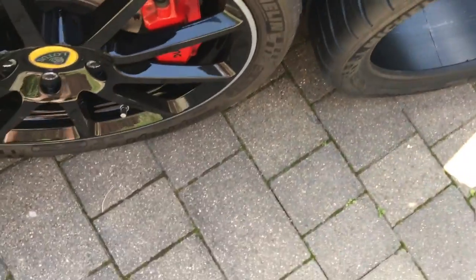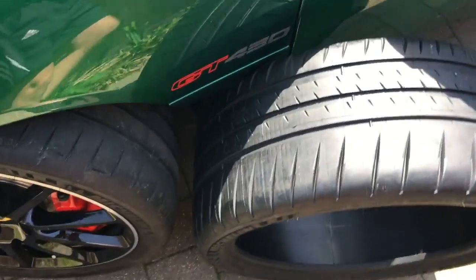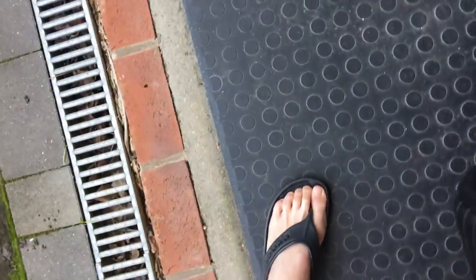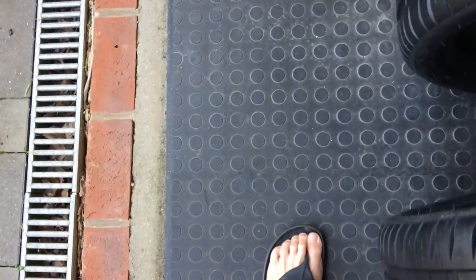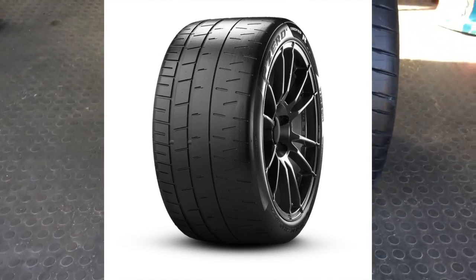Because I am seeing much higher wear on this side of the car, and I think that's why I'm getting feathering on the edges of that tyre. So — anyone else running Michelin Pilot Sport Cup 2s, let me know if you've had a similar experience. It would be interesting to know if there's anything to the theory. Until then I'll be making a greater effort to swap tyres left to right between track days, and I'll also be trying some of the Pirelli P Zero Trofeo R. They are also not directional tyres, but I didn't experience any issues like this with the Pirelli Trofeos that I ran on the Exige, and the tread design looks better in terms of swapping left to right.